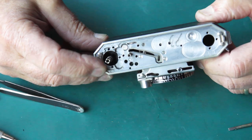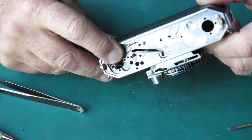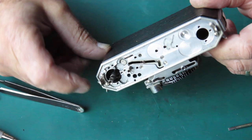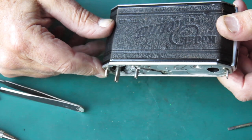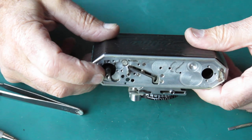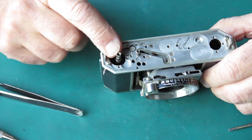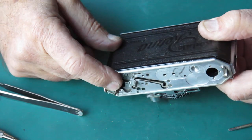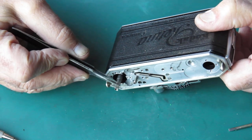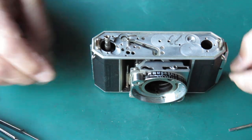If I was looking for a reason for that to have happened, I would say the camera had been dropped on its head, possibly with the film advance lever sticking out at an angle. That top is just bent over. The hole down the middle of that squared-off shaft removes a large amount of metal — there's quite a thin wall of brass there. So this shaft at the top has just died. I'll try and straighten that up; I may have to replace the whole shaft. That's why that screw was stiff to come out and stiff to go back in — this whole shaft has changed, so the thread profile inside it has changed.